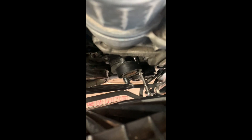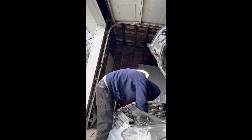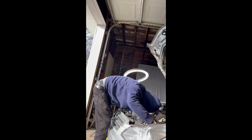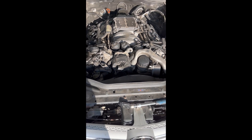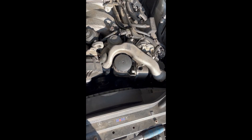It's on the end of that extension there — you want to go to the right. I read it online or saw another YouTube video, but Mercedes — Germans are smart — they designed the idler pulley so it destroys itself if any of your other pulleys break. Kudos on that. And this thing is only ten dollars and it's at the top so it's easy to get to. Got that out. I guess we're gonna go for the tensioner pulley next — I think that'll be the easy one. See you guys in a second.